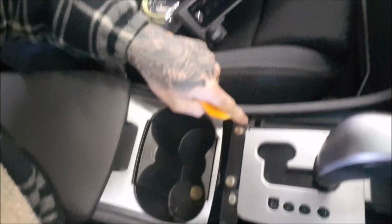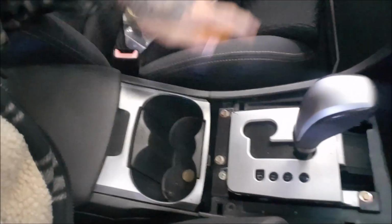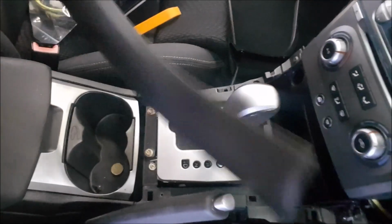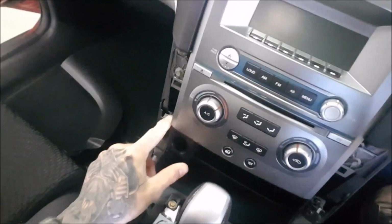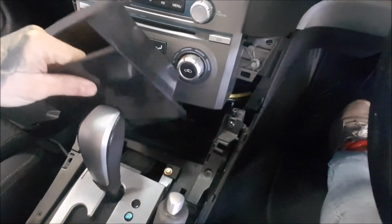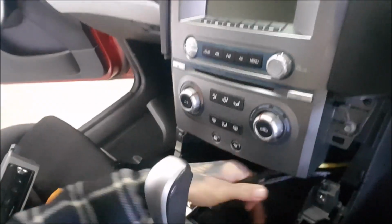Then you've got two Phillips head screws, which this one we prepared earlier, we've already taken out. So you can remove these two side panels just by removing those Phillips head screws and then lifting those out of place. The next step is to take out the factory pocket. Some vehicles will have screws in these two locations, some will actually not have screws and it's just clipped in. Either way, you can lift that out, unplug the cigarette lighter socket, which we have pre-done in this circumstance,